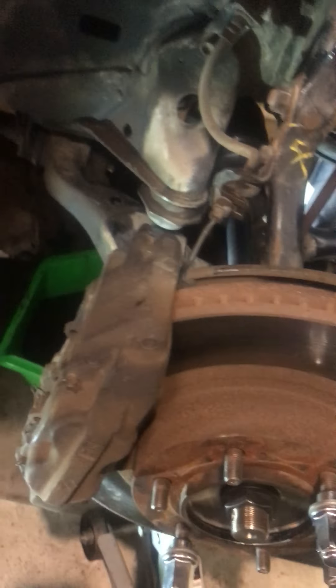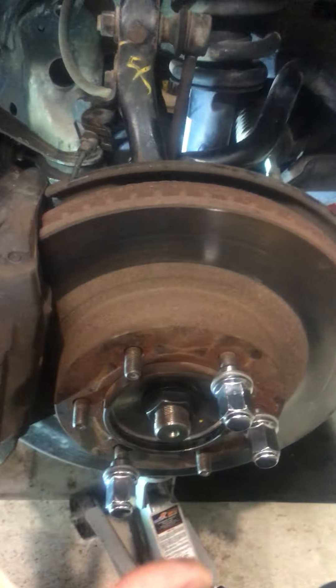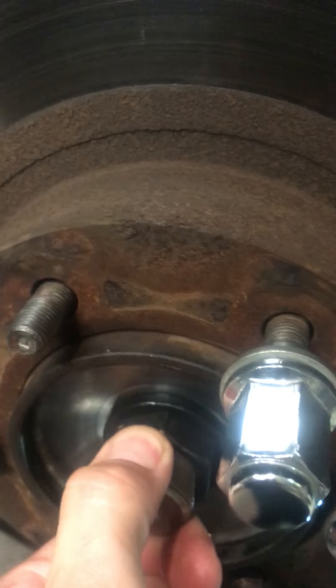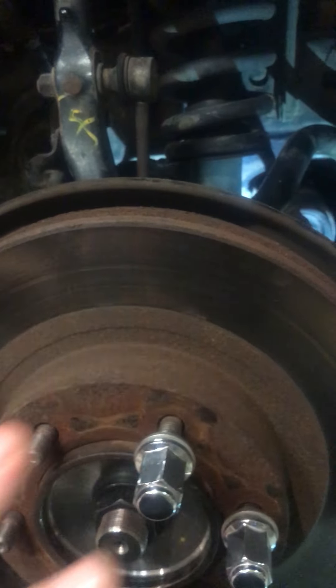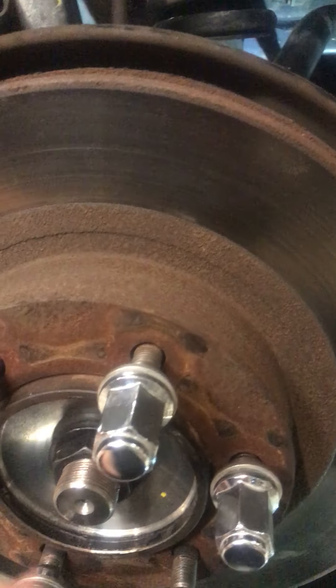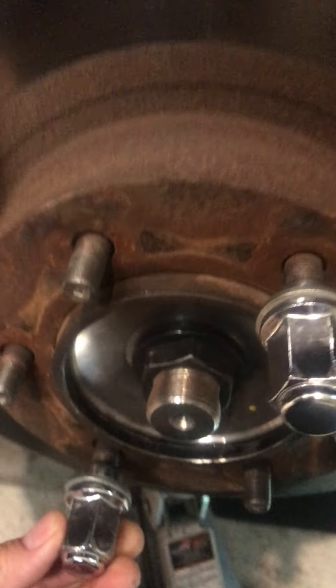Basically, I brought this assembly round onto the end of the splines, jacked up the lower part, put the two 19s back in, dropped the tie rod end back in, put the sway bar back on. This part was floating backwards and forwards, sticking through, and all this assembly was back on — but the back drive shaft wasn't fully seated. I'd slid it in the hole but the snap ring wasn't in.